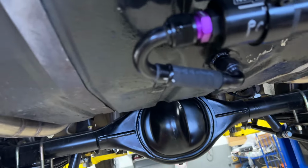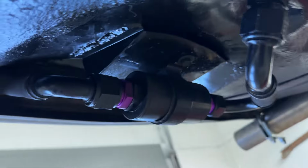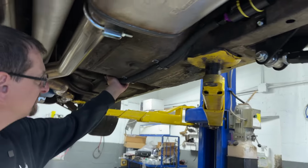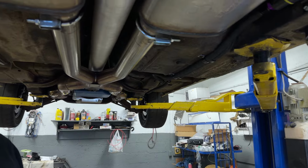This is the fuel line coming out of here. This fuel system has a constant return system where it's fed up front to the regulator, and another line feeds the fuel constantly right back to the fuel tank, so it keeps it flowing all the time. There's a fuel filter there, and another fuel filter back there. Why two? Because you have your feed and your return. That keeps a consistent pressure up at the fuel pressure regulator, and helps keep the fuel a little cooler, just moving it back and forth instead of having it deadhead. I may be corrected in the comments, but that's kind of what I was told, and it's working, so I'm going with it.